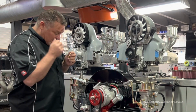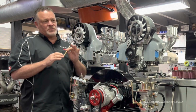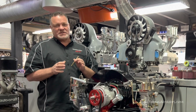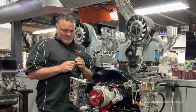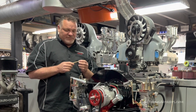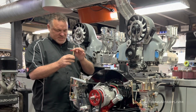So after a little bit of work, we finally found the problem with this. What it was doing is when we came up to the high RPM under a load, and we get into the main circuit, the motor would just lay flat, flatten out. And we kind of chased a few things around thinking we found it, and finally figured it out. So what I have here is the main jet, and it wasn't seated all the way